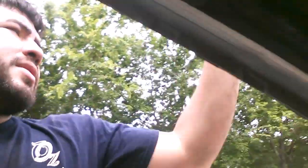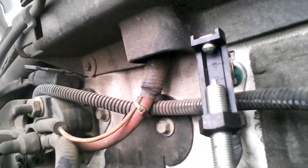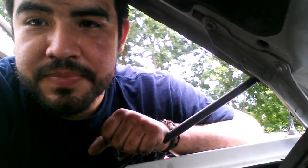As you can see, I opened up the electrode and we didn't get any spark, showing that basically we have a weak or damaged COP — coil-over-plug. You can use this tester as well on spark plug wires and all that good stuff.